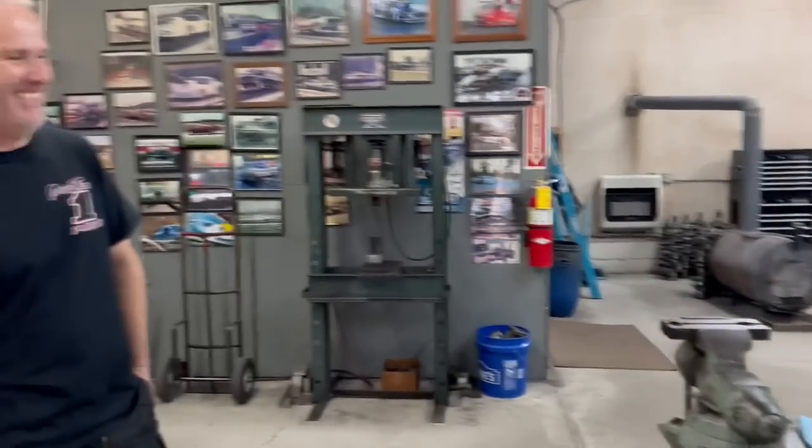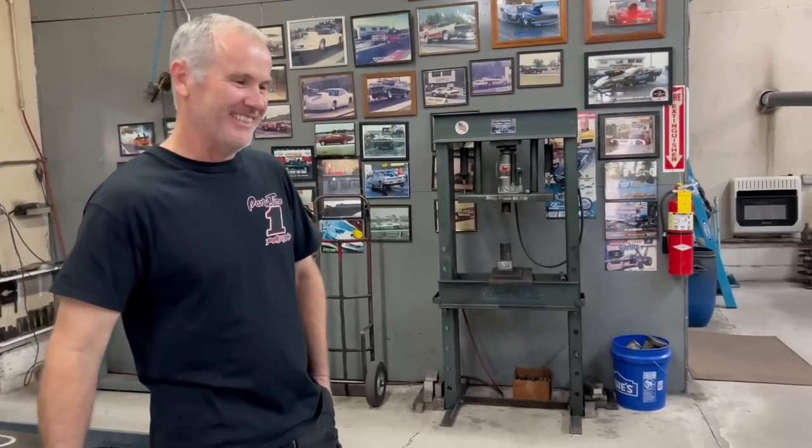Is it? Nice. Well, what do you think? So going from a 3.34 stroke to a 3.75 stroke, compression is going to go from about 10.5 to 12.9. Woo! That's going to be the issue. Yeah, right. What do you think? Just take 3 or 4 degrees of timing out of it? Yeah, you don't have to. Keep your heads on. Oh my God, you just said what Randy says. Blow the heads off of it. Randy likes to blow the heads off of stuff. I don't want to do that.